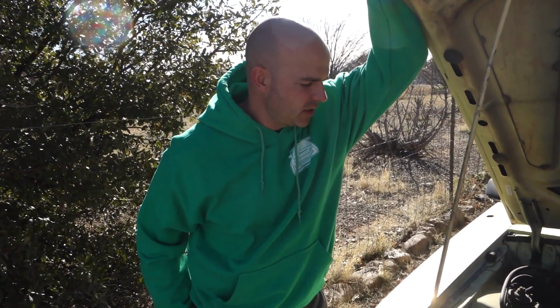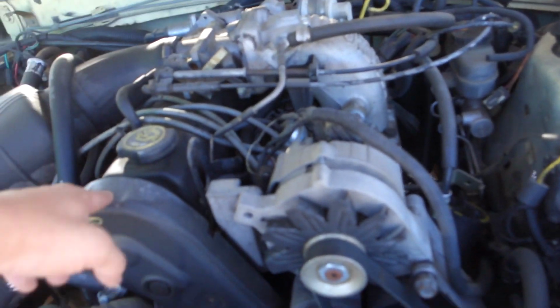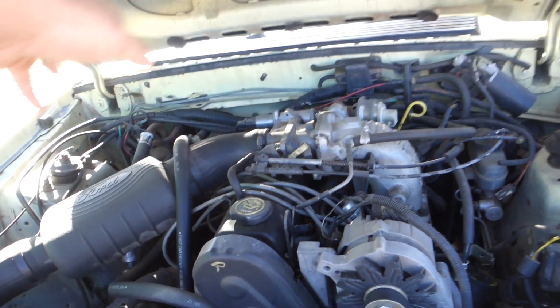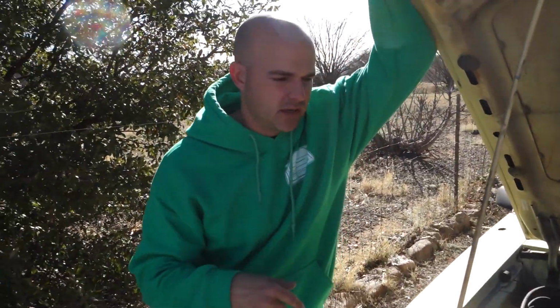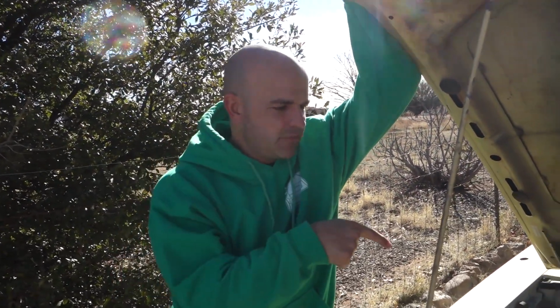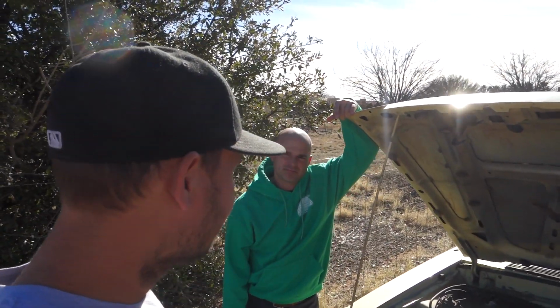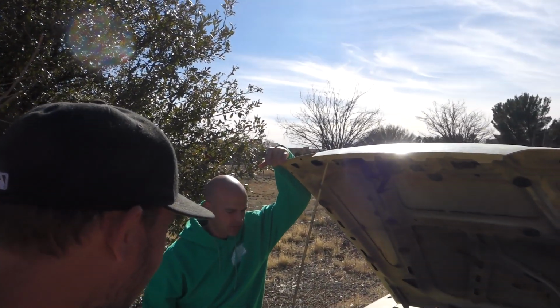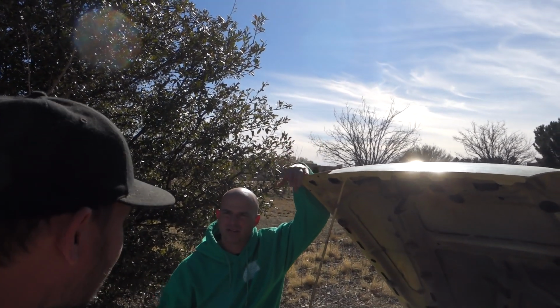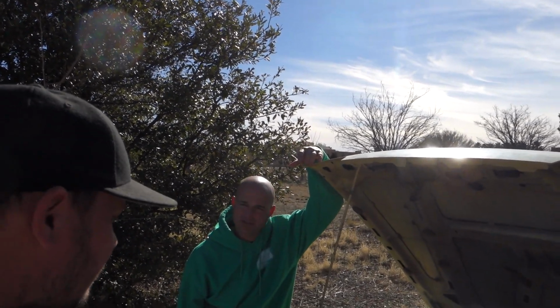Okay, so what are we doing for horsepower? Well, I've already procured two 302s. Okay, so another question: 302 versus this 2.3, you said? Yeah. Transmissions, both T5s, I don't know. This is a T5, but the guy I bought it from said that this T5 is a weaker T5 that's made for the 4 cylinders, so I can't imagine it'll hold up very long if that's the case. The V8s are somewhere around 220, 230, 240. So I don't know, we'll see. They mount up to the bell housing, so we're gonna send it and see how long until it blows up.